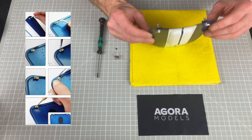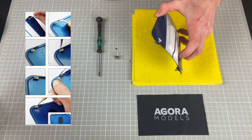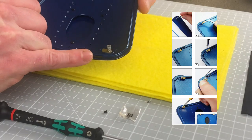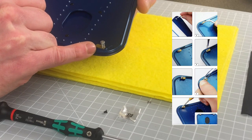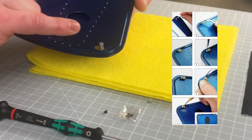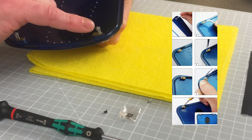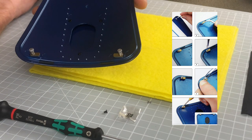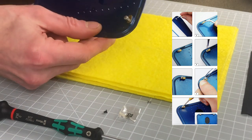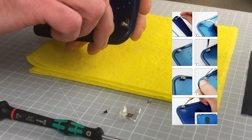So what you've got is the hood handles, which are plastic chrome plated. So they've got a shaft on them and they go through a hole through the bonnet. And then we have the brass hood latch, which is the actual locking mechanism. Then we have a spring. Then there is a locking ring above that. And then there is the screw, which the one I used for that part was the OPO1 screw. So it was a case of just holding them all together, putting your hand on this side of the bonnet and just screwing in the part.